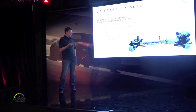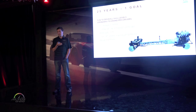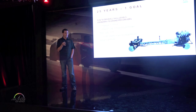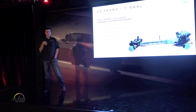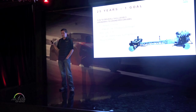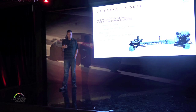Making it lightweight with low inertia and keeping the power low has been a consistent part of the strategy. Lightweight and low inertia make the car easy to push over the limit and bring back. The low power thing is maybe not as obvious, but if you want to tune the car to be neutral and balanced, you want consistent behavior on and off power. If you have 300 horsepower and hit the gas, the rear tires lose all their grip — so in a high-power car you inherently have to tune it to be less balanced off power so it can be balanced when you're on power.